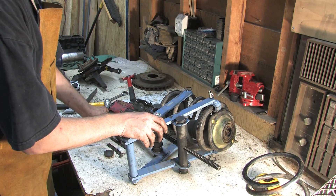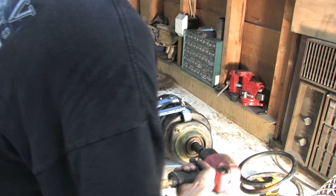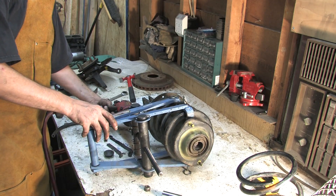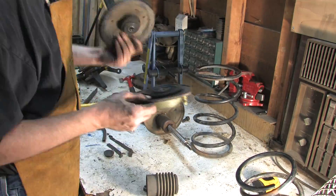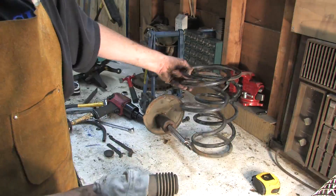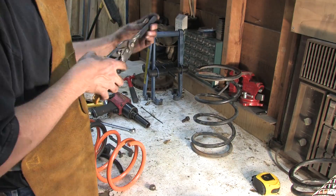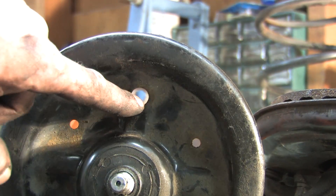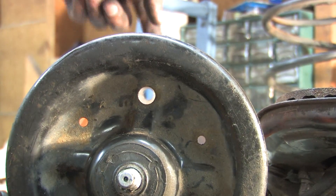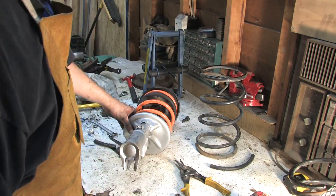First, compress the springs with an impact wrench. Then use a 19-millimeter socket to remove the nut from the top of the strut. All you have to do is loosen the main bolt and the springs safely decompress. So I've got the hat and the perch — the rest of this stuff is junk. Time to put the other one together. Check to make sure you've got the perch lined up with the strut. There's a sight hole in both the top and bottom perch that you can see through when it's all aligned correctly. Once lined up, install the hat and the nut to secure the assembly. Make sure it doesn't spin when you're tightening the top nut — I caught it and fixed it off camera, but just be aware it can happen.